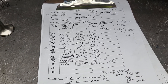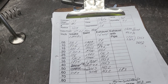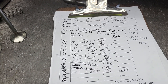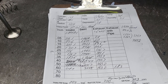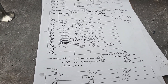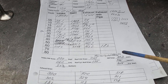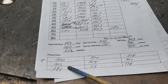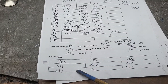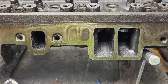The swirl is going to help if you build a street engine out of these heads. Somebody said a while ago, take a pair of these and hook TPI up to them — they'll be freaking beasts. There's some truth to that. Let's finish these numbers first — on the exhaust numbers, fairly good side to side, a little dead in the bottom, not bad where it is.